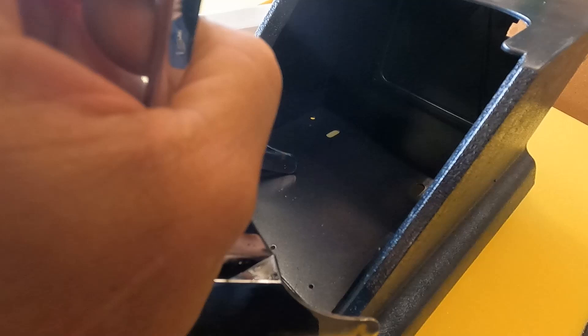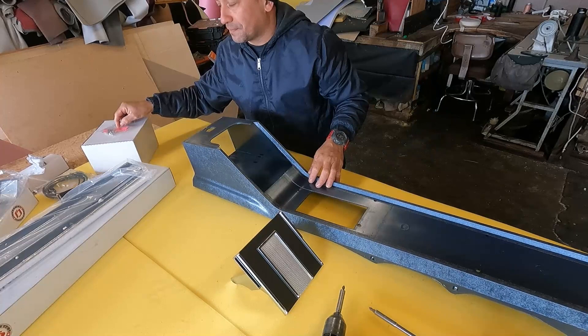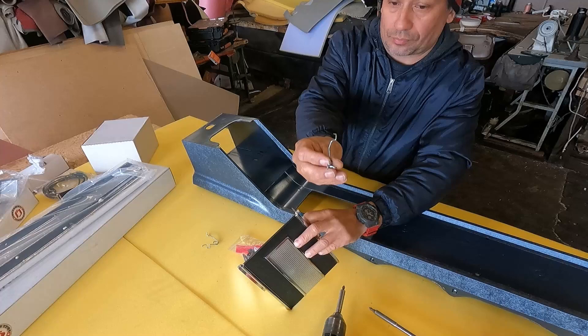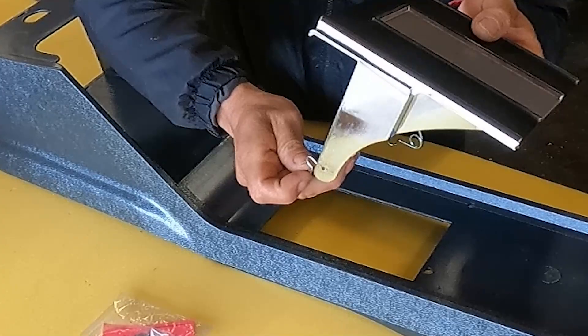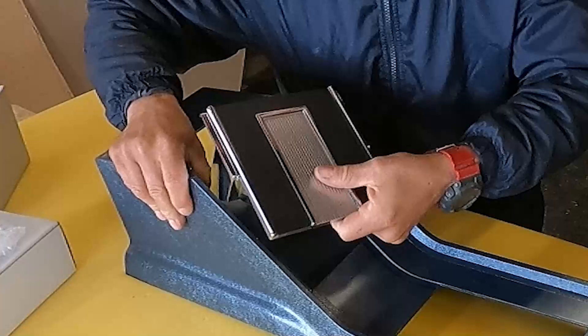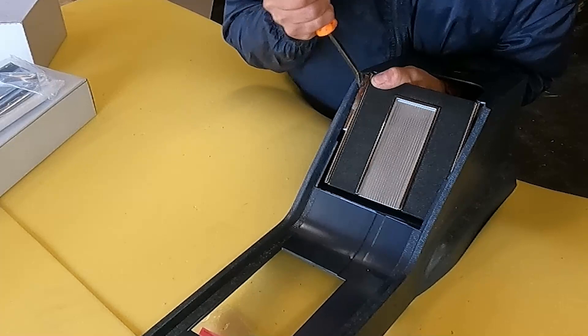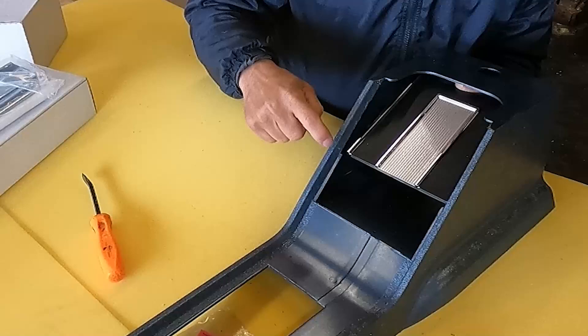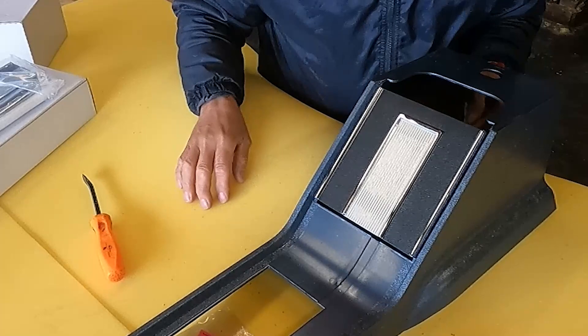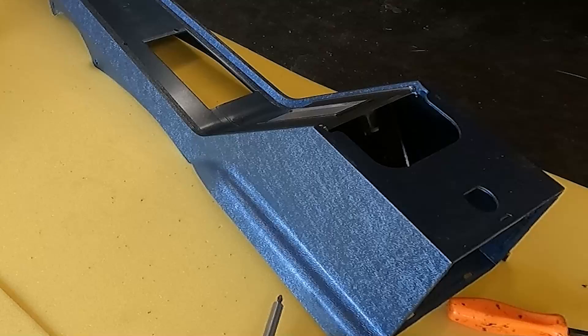Right there is like a door — this is the part that I'm going to put on there and you will see how that part goes in. I'm going to start with the front part. When you buy it, they will send you two wires — look how those wires look. You have to put one on the top, and you will see that shape. Those wires have it on the bottom; you have to screw it to the plastic or the center console. You have to put that part in and make pressure because it's not going in easily. Use a flat screwdriver and force it a little bit and that part will go in. That is the bottom of the center console. The part has to be over the plastic, so I cut that part. See how there are like three holes on its inside — on one of those holes you have to put a screw.